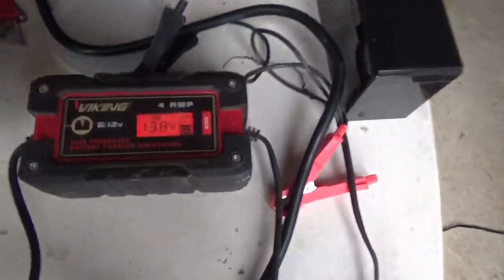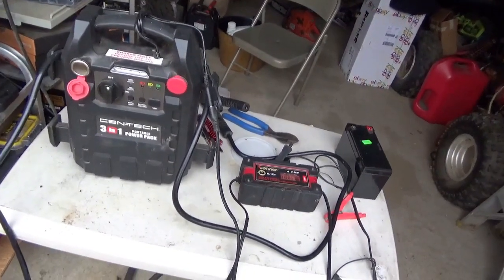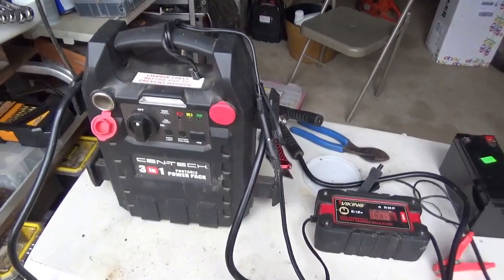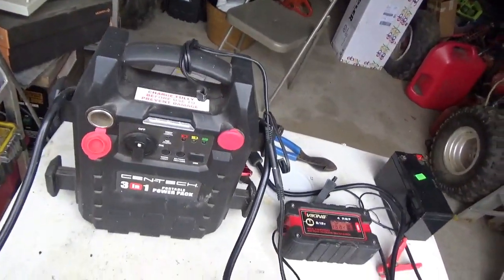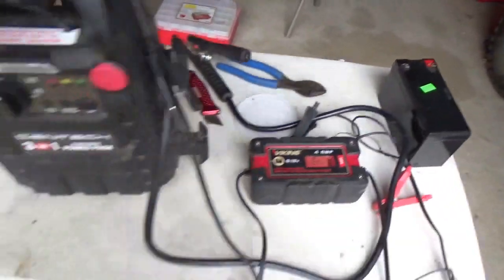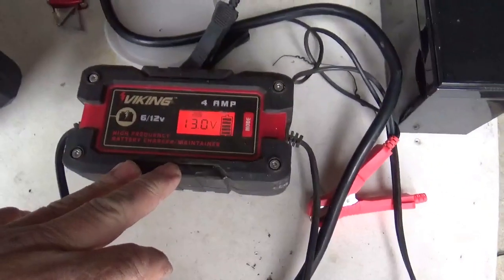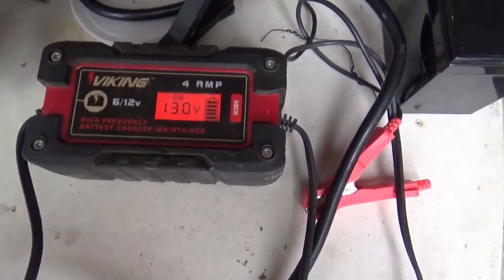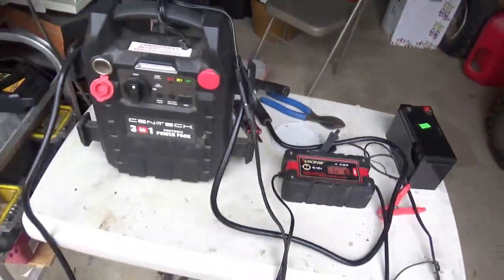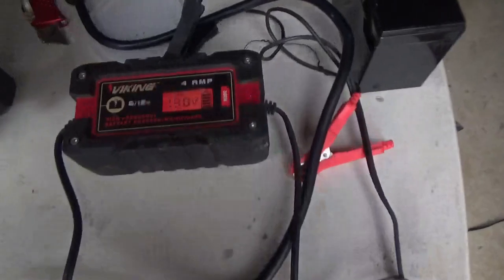You can see I put the wire on it, and now I can trickle charge it — and that all works out beautifully. Generally speaking, these batteries like to be warm when they're charged. Not hot — don't go sit them on your wood stove — but if you bring them inside, get them up to room temperature, and charge them that way, they seem to take a better charge. This is all done. I just put this on here literally two minutes ago — you can see it's all the way to the top, and it just turned green. Now it's just floating, and it can stay like that forever without drying the battery out.